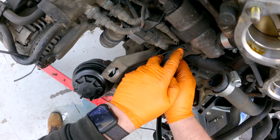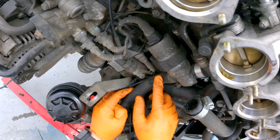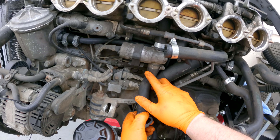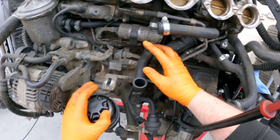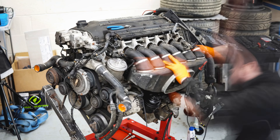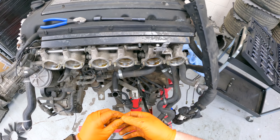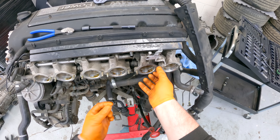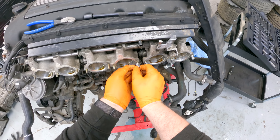This is one reason I wanted to do this — to change all these hoses. They're all cracked, all going to be giving you little vacuum leaks, causing rough idle, little things like that. Stuff you might take for granted and think, 'oh it's an old car,' but it's a '97 and they figured out a lot of that stuff by then. Trying to stick to something Aston taught me — always put nuts and stuff back where they came from so you don't lose them. A very good tip.